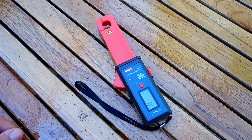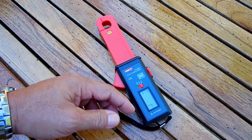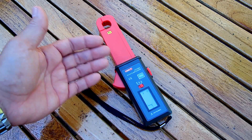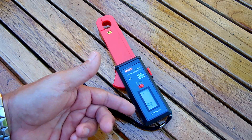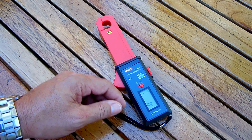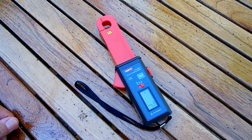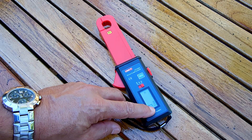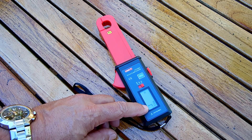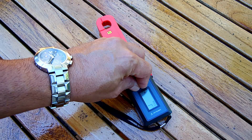So before using the unit, you would have to zero it out using this knob. Keep turning it slowly and you're right around zero. Keep in mind, you don't have to have this exact — you could have it showing 5 or 10 and then just add or subtract that amount from the reading. Right now for all practical purposes it's at 0 milliamps DC. You can also do hold — that's data hold — and that reading gets stored for access by your computer later.